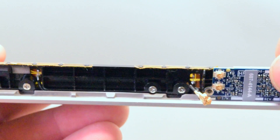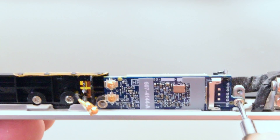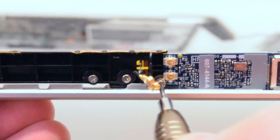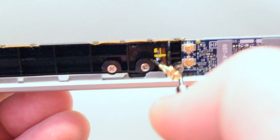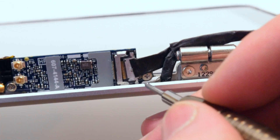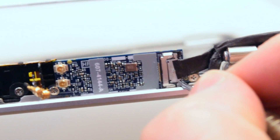Place your new airport card in the following orientation. Go ahead and attach the right side Phillips head screw. Now go ahead and attach the left side Phillips head screw. Reattach the main Wi-Fi cable to the back of the card, gently prying it in with the screwdriver if you have to. Now you can go ahead and click in the antennas.